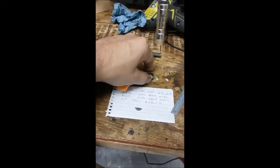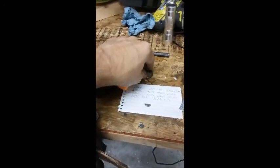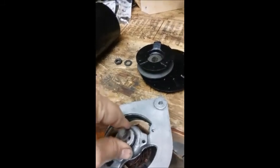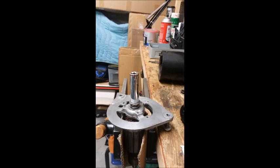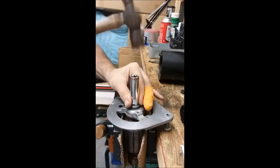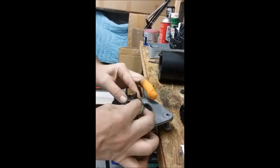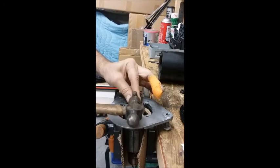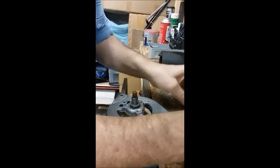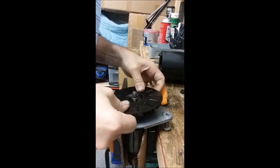The diagrams aren't very clear, so I wanted to document this — it took me a while to figure out again going through my old pictures. Next, a collar goes on, then a washer. You can take the same socket and drive it home. Then the little Woodruff key goes on — I haven't put it all together with the Woodruff key yet, so I'm hoping I ground it right. After the Woodruff key, the fan goes on.